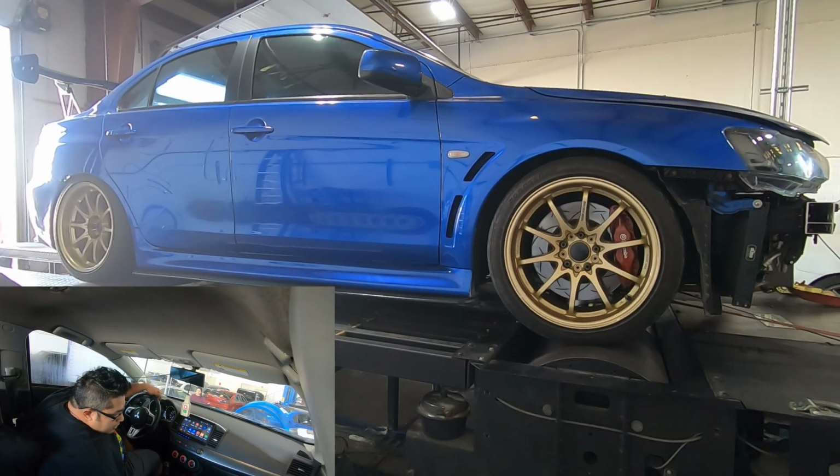So that was just a test. I wanted to see if the boost controller and its ceiling is working, basically your fuel cut, and it is. So I set it to 33 PSI and I set the boost to 35 PSI, and checking the logs, it started the timing retard and fuel cut with the hysteresis being around 2 psi. So everything is on point. I'm confident now that I can push the car and still have my ceilings and my floors in place.